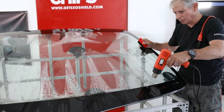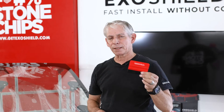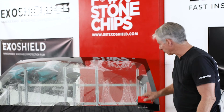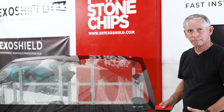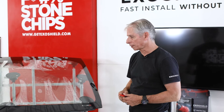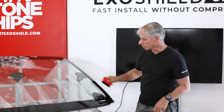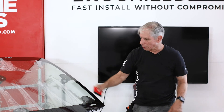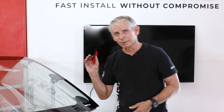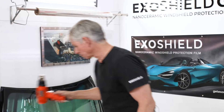This card doesn't do anything — all it's going to do is show me what I just did with the heat gun. You cannot manipulate the film with this card. All it does is show us what we did. If I push through the finger and split it off, it'll show me what I did with the finger. The other thing this hard card does really well is push all the water out. If you constantly use this hard card, all you're really doing is pushing water out — it does nothing else. The only thing that can manipulate the film is heat.